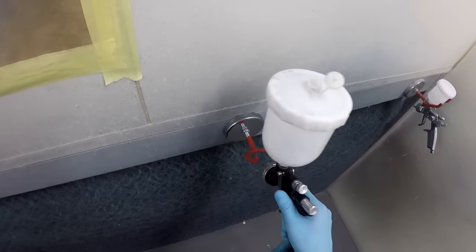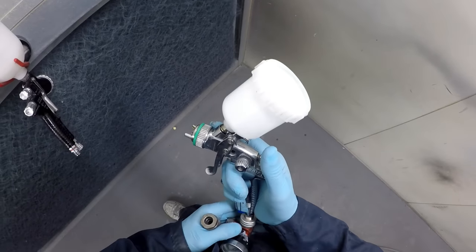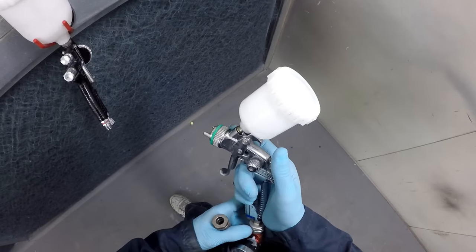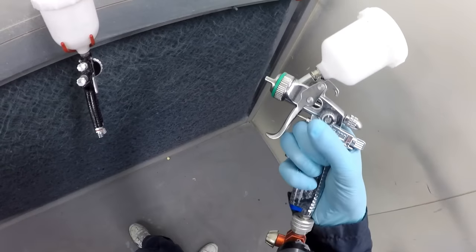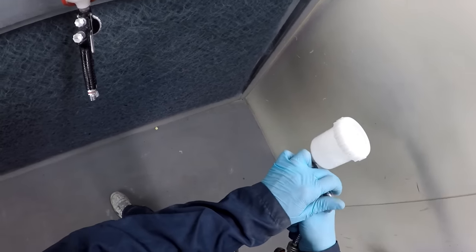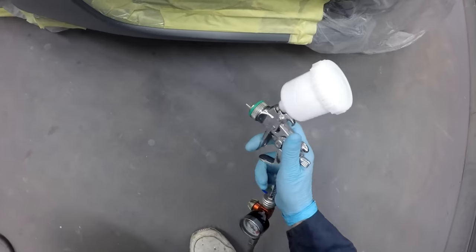Once it's baked off it's going to be a really quick nib with 2000 wet flat and a quick spot polish, then a quick nib and polish on the two blends at the front. I've got the Sata Mini Jet here with just a little bit of fast thinners — you don't necessarily need fade-out thinners but it does work a little bit better. We're going to remove the false edge and then gently blow a little bit of thinners over to melt new and old paint together, making this little blend that much easier to polish into the existing paintwork.